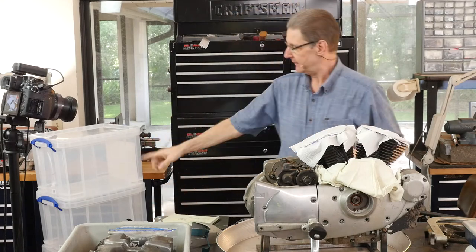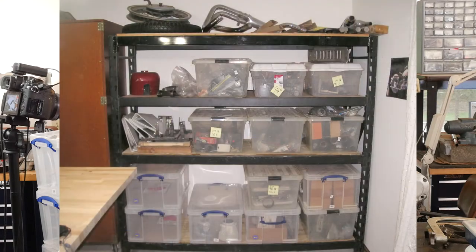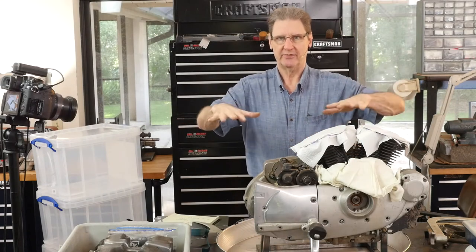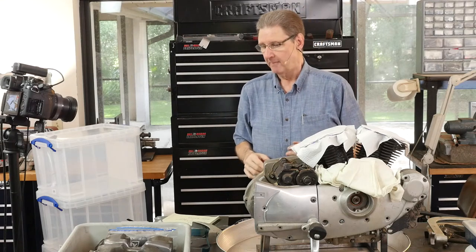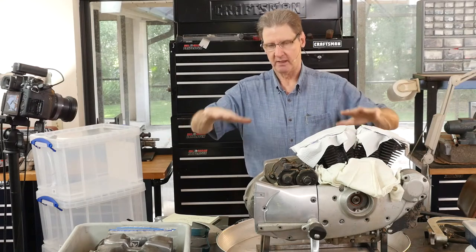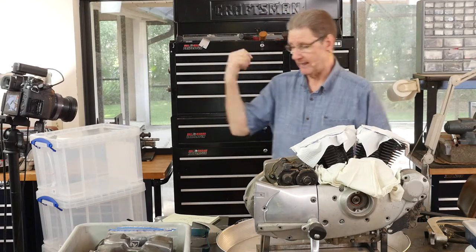Here in the side room where I store the Harley stash, here's a picture of the Gorilla Rack I got at Home Depot decades ago. The Gorilla Rack works out good — you can set the shelves. They put cheap fiberboard for the shelving, but you need to find plywood and replace it. Cut half-inch plywood to fit because the fiberboard is way too thin and too flimsy for Harley parts. You could put the plywood down and save the fiberboard on top, but I'd pitch the fiberboard.